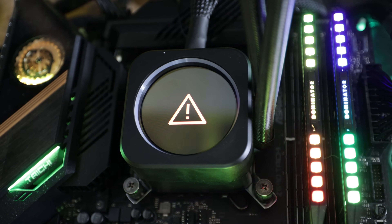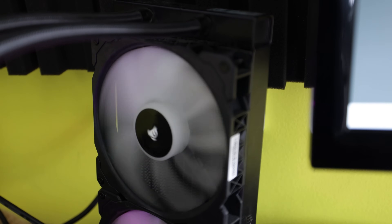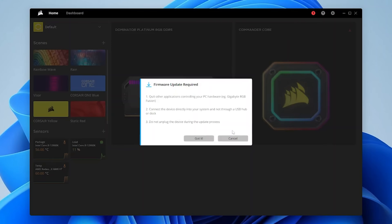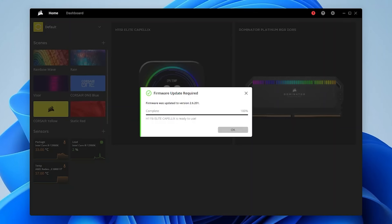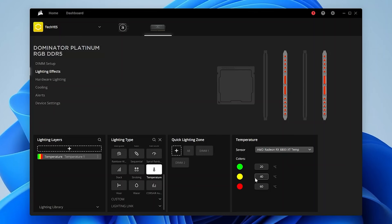As I was installing this piece of hardware, I noticed it started flashing red with an exclamation mark, and this was also reflected on the included fans on the cooler. To get around this, I downloaded the latest iCUE software from the website — you may have to uninstall your existing iCUE software and then install the latest version. Once I did that, it asked me if I wanted to update the firmware of the H115i Elite Capellex, and as soon as I updated the firmware, the LCD screen came completely to life.